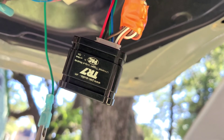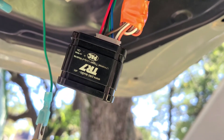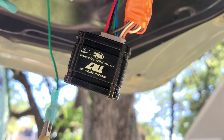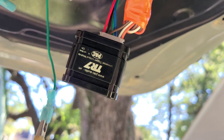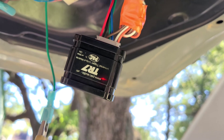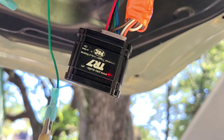Now we've got to enter time mode, so we're just going to trigger it once. That was one blink for minutes. That's two blinks for tens of seconds. Three blinks for individual seconds. Now I trigger six times: 1, 2, 3, 4, 5, 6. We're done triggering. The device confirms: 1, 2, 3, 4, 5, 6 seconds is our timer, and then it's going to cycle through its own blinks which means it's done programming.